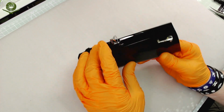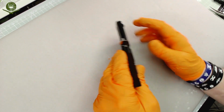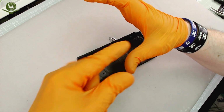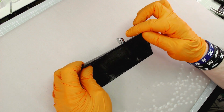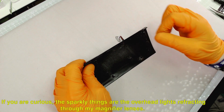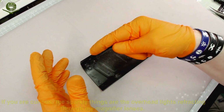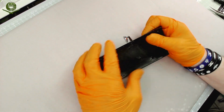We started the door. I did have a lot of trouble getting the mirror part to actually screw into the arm that the mirror sits on. You basically have a piece like that, and then a screw goes in and screws it into the arm. It's a CM screw, which is a metal screw, and it's going into a plastic tube, and the plastic tube is barely big enough to hold the screw, and it goes in so far and then just stops. But the mirror is still wobbling around, so you really have to keep pulling the screw out, putting it back in again, and adding a little bit of extra pressure every time to get that screw to thread its way in. So it can be quite tricky.